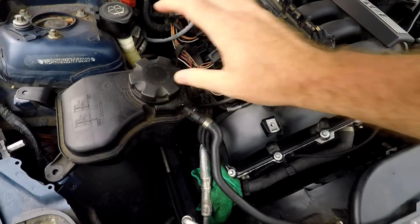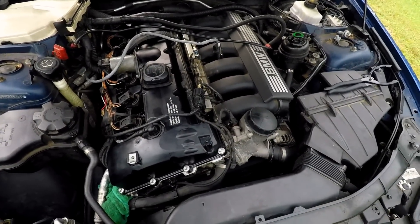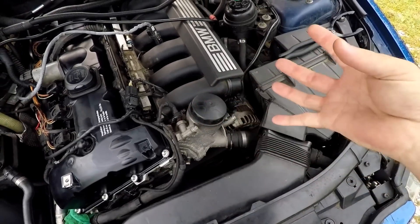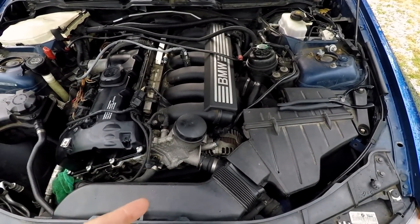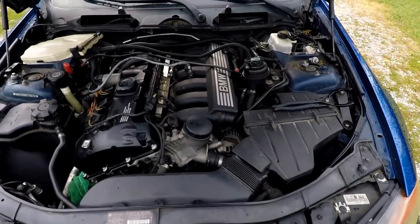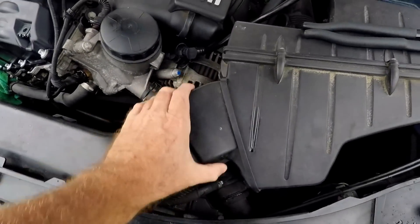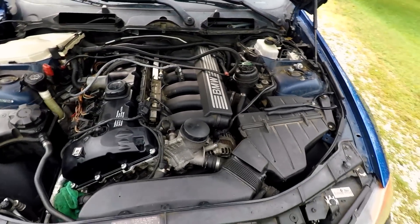Look at the coolant — open the lid. Does the coolant look good? Is it the BMW blue coolant or standard green? Either one is fine, but has somebody mixed in orange? Does it look like mud? If you have an oil filter wrench, bring it with you — unscrew the oil filter and look at the filter. Is there a bunch of junk stuck in it? How does the oil look? Is there water mixed with the oil? Does the oil smell like gas? There is no dipstick on these — you check the oil level inside the car on the display. If the oil smells like gas, it's probably been there a while. Ask the seller and see if there are service records. Has it been serviced at a shop? Go through and look — is stuff misplaced? Are clamps or bolts missing? Is there stuff laying loose in general? Those are all things to worry about.